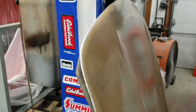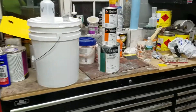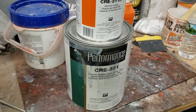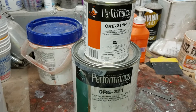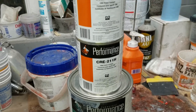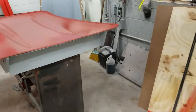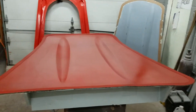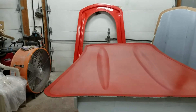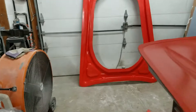It's quick setting, which is to them 24 hours. I'd also like to talk about a new epoxy primer that I found. I don't make any money off these plugs - just when you find something that works you like to spread the word. It's CRE 321 and it comes with two quarts of catalyst so you get about a gallon and a half of usable product. It is a high-build epoxy primer that is sandable - that's a first for me. You spray it, wait six hours, hit it with 220, and it doesn't clog up the sandpaper. I wouldn't believe it if I didn't try it myself - I thought it was bullshit but it does work.